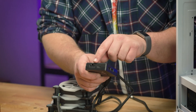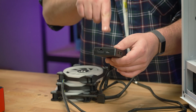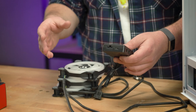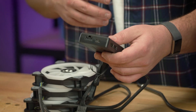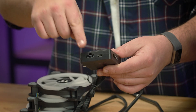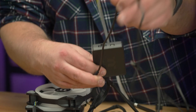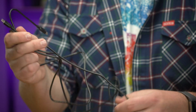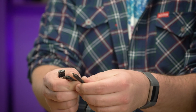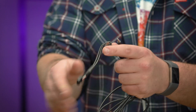This is what's used to power the controller. Depending on your controller version, they'll either have an end that is a Molex connector or SATA. That connects the power. On this side you'll have two other ports. This one here is called a bridge, and this is what's used to connect multiple controllers to the one controller — essentially like mirroring. So if you have a lot of RGB fans and want to use 15 fans with three controllers, you can bridge them all to one. We'll also use the included USB micro splitter.